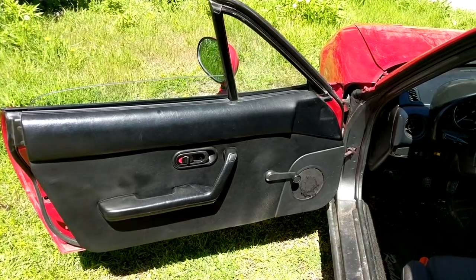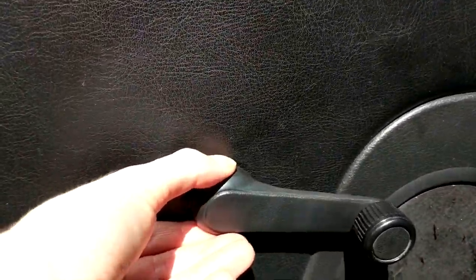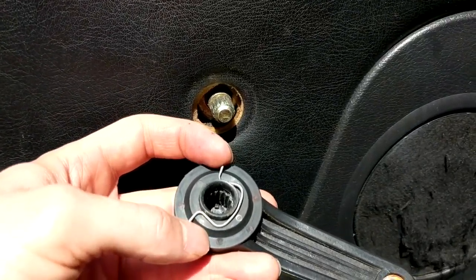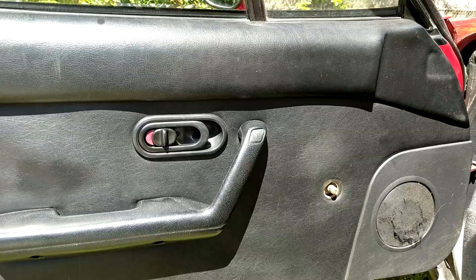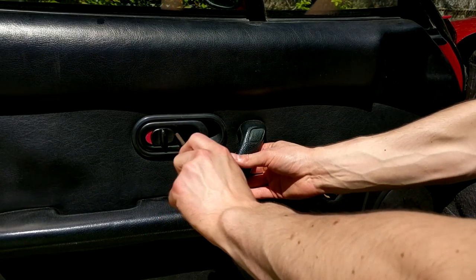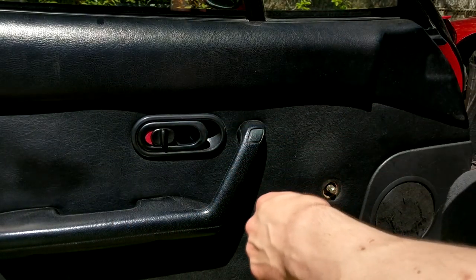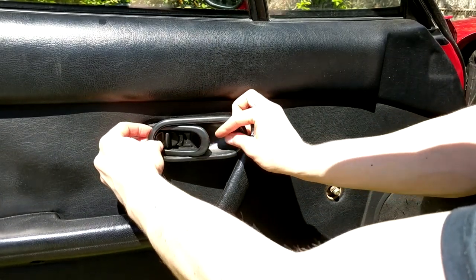Let's start by removing the door card. The hardest part by far is removing the window crank. Basically what you're going to see is you're going to have this clip thing — while it's still attached to the door you have to pull back and pop it out, then pull back and pop it out again, and then this door crank should just come off very easily. Next, remove this door handle piece: grab a star screwdriver and take off the screw you can see inside. Once you have that, open the door as if you were trying to get out of your car and this should just pop out.